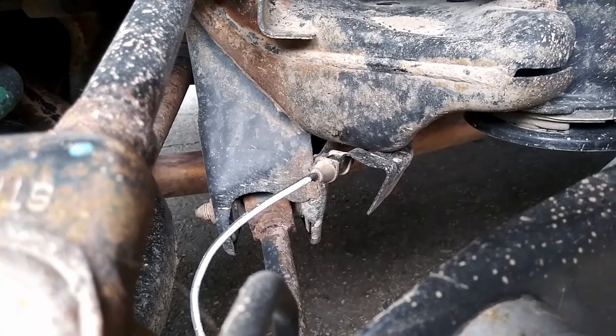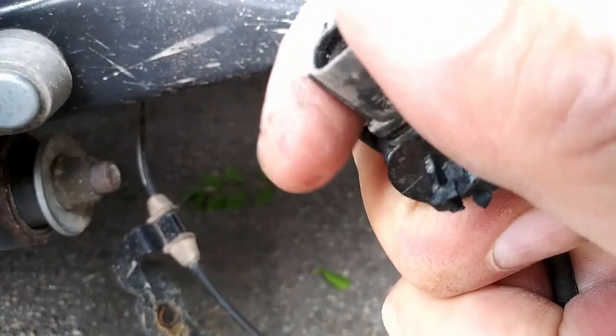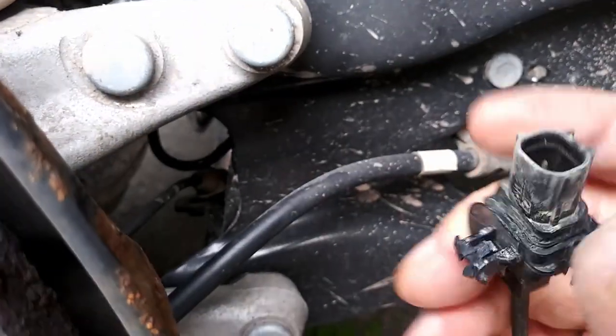I got that bolt out, that bolt out, and even that bolt out. However, where the actual sensor goes into the hub is stuck there. Hopefully I'm going to get a screwdriver and it's just going to pop right out. It's actually kind of tricky — there's a little lever pusher thing that kind of pulls this up and disengages from this pin. There's a little gunk in there, so I actually had to get under the car to get my arms up there to pinch and pull at the same time. But it did come off.